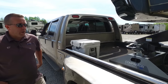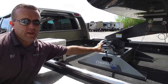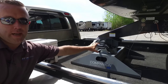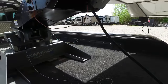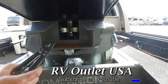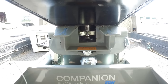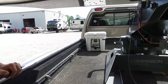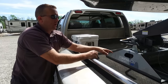The very first thing I want to do when I get out of my vehicle is make sure that my handle — whatever design hitch you have — is closed. If I see that the handle is closed, the next thing I do is go around to the end of the hitch and look inside the face here. I want to see that these jaws are closed around the skinny section of that pin. If the handle is closed and the jaws are around the pin, you are latched.